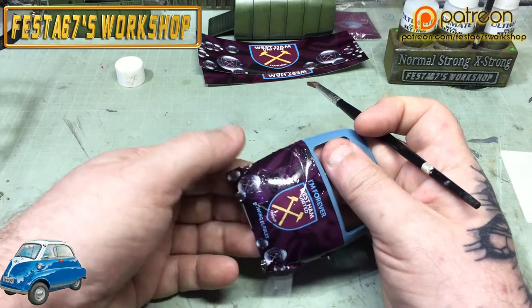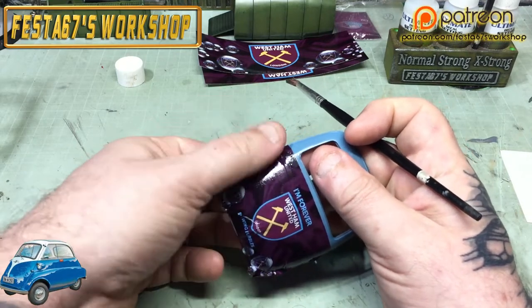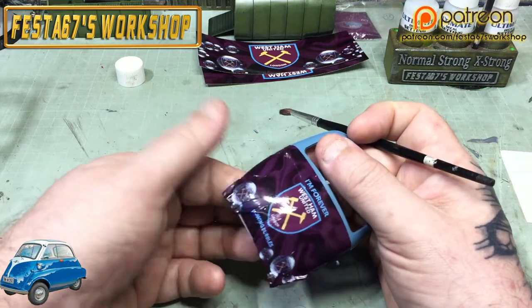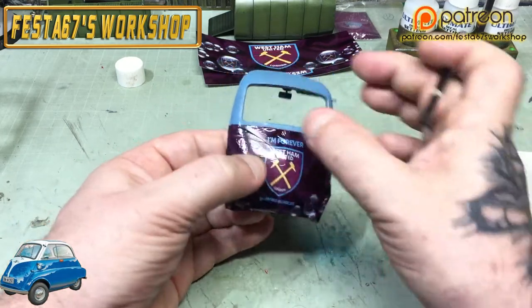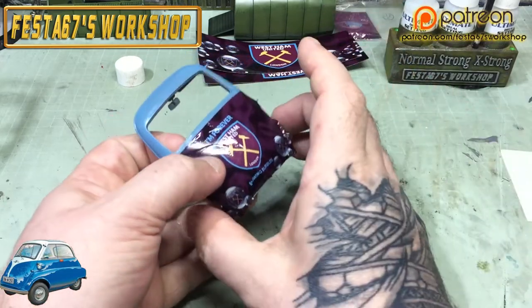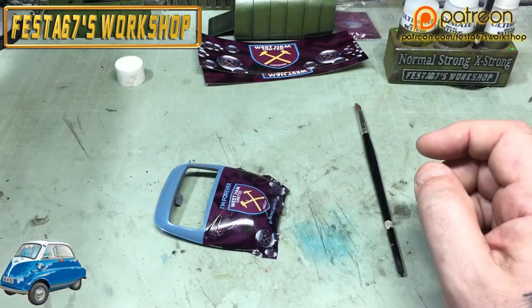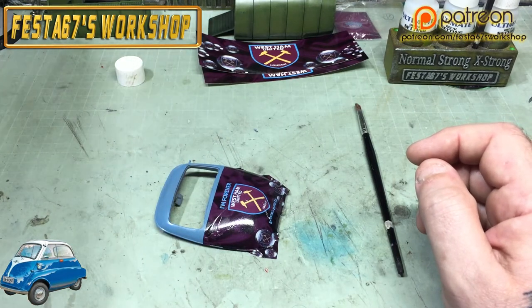these creases. And it's just literally lose them in the corner, gather them in the corner, and then stretch the corner out over the panel, and it will pull all them wrinkles over the edge, and then it will shrink back, boom, suddenly you've got a decal that is conforming to a multiple compound curve.